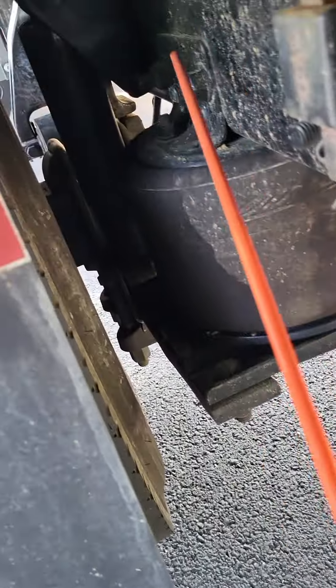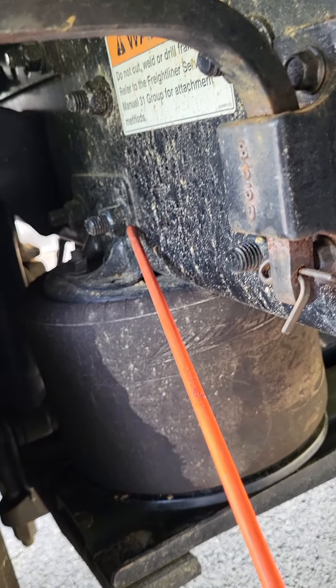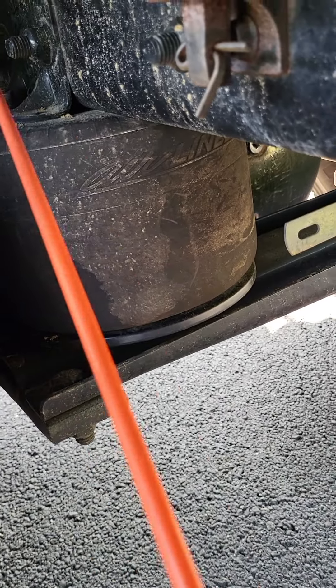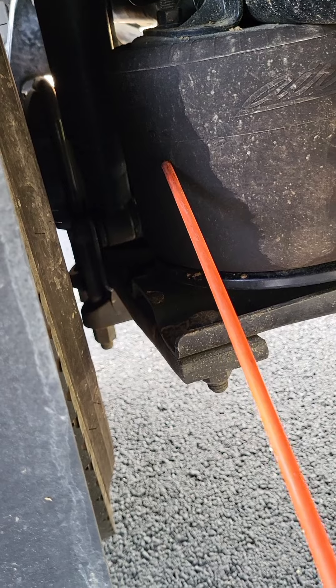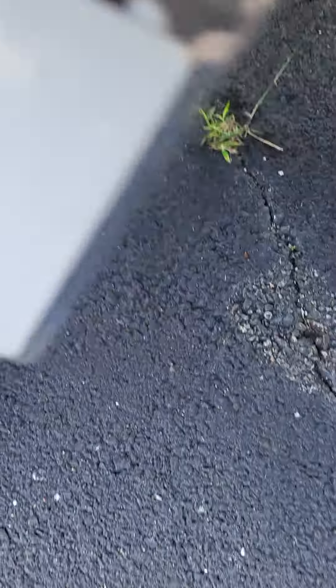Here's our different part — these are airbag mounts. The airbag mounts are not bent, broken, or cracked — not missing any nuts, bolts, or screws. They're top and bottom. Then we go to the airbag itself. The airbag is rubber, so it's not cut, frayed, dry-rotted, or bulging, and I hear and see no leaks. That completes the suspension.